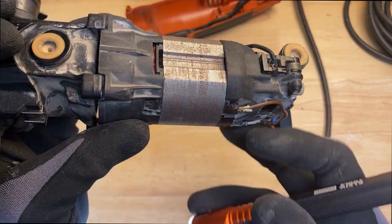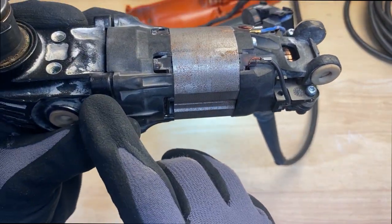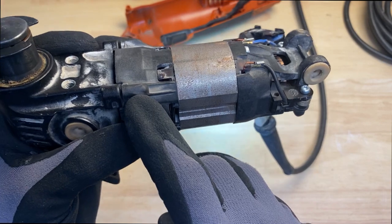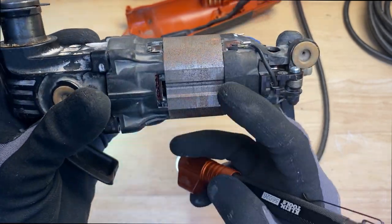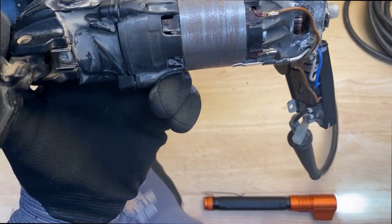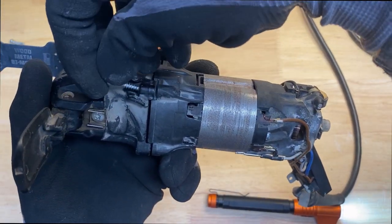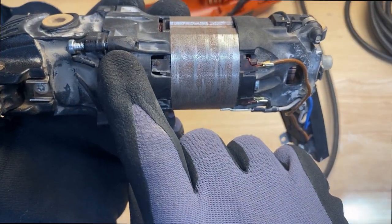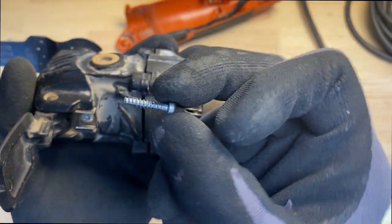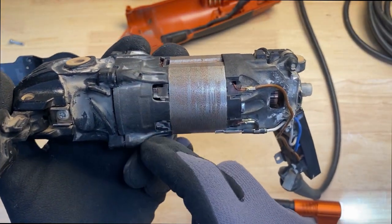So we've got 2 out of the 4 screw holders where the 2 cases mount up. 2 look like they're compromised, and the other 2 look pretty solid. And those are the 2 areas where the screws back out. So these screws here, they just back out of the hole over time. Maybe because it looks like the plastic is burned onto these screws. Can't really see it in that photo there, but this is probably augered out in here.